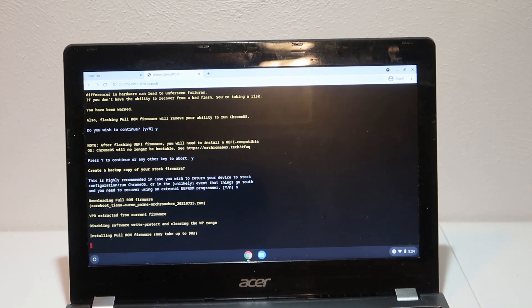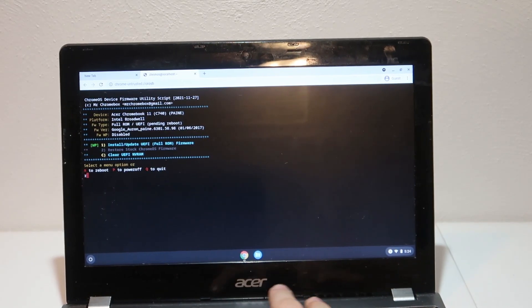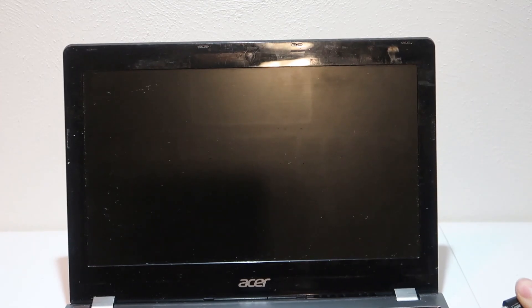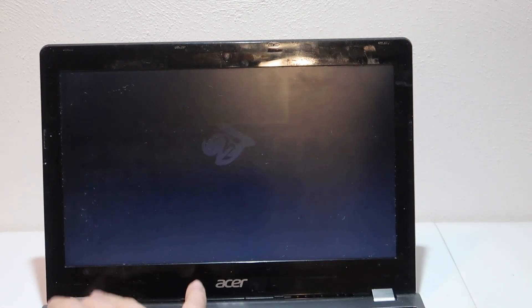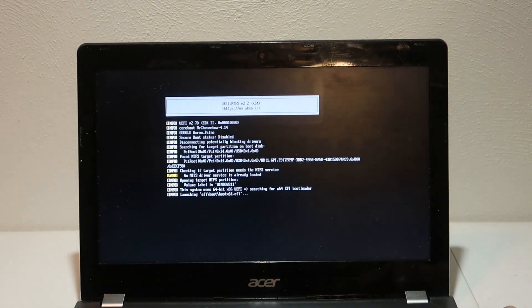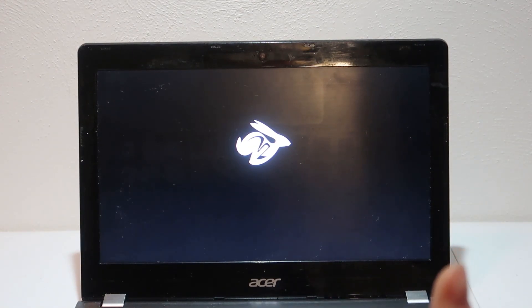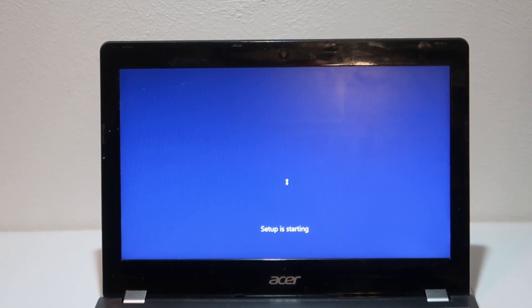If you're installing Windows 11, you need to have a custom installer USB because Windows 11 has UEFI and TPM requirements, and this Chromebook definitely is not supported by any means. So we are going to have to make a custom USB, which I've already done. The first boot of the UEFI system will take a while because it's a brand new ROM. Once it boots, the first thing we're going to do is spam the Escape key, because that brings us into our boot options. Here we are inside our BIOS - go down to Boot Menu, then select USB disk 2. If it boots successfully, we'll see the boot logo and the spinning wheel. You will need a USB mouse because the touchpad on Chrome OS does not work without drivers, so go ahead and grab one now.